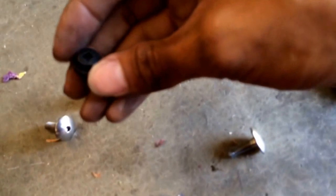You'll notice 3 of these push pins. Let me see if I can get this right. There's 3 push pins right here next to the radiator: top, middle, and bottom. And the ones that were really getting me stuck were on the other side, this guy right here. It's kind of a mixture of a push pin rivet and an actual Phillips. Those are easiest to get to on the other side of the bike. Turn the wheel, approach from the right side of the bike, and you'll remove it from there and there. That's the push pin rivet, and that's the actual Allen.